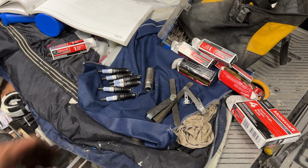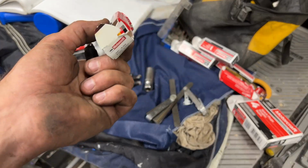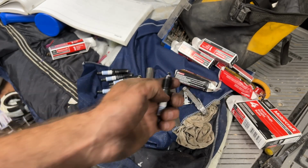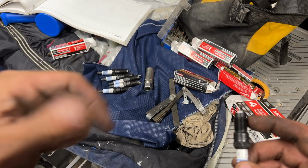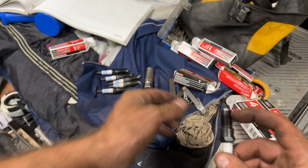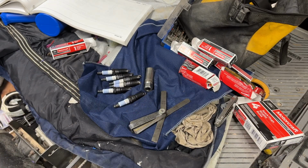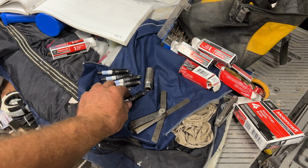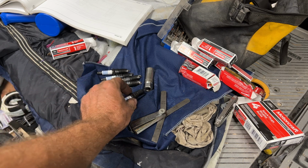Okay, the next step to the supercharger install, we're going to install some new spark plugs. These ones are SP440s. They're the recommended ones for the SOHC engine. The normal gap for Rangers, well, this year Rangers anyway, is 62 to 68 thou. But we're going to bring this down a little bit. We just set it to 54. So it's tightening up the gap a little bit because you are using a supercharger. But again, I'm running such a low boost, it shouldn't really affect the spark much. If you were to go higher, you want to close it down. I believe in the manual, the instructions for the Moddbox kit, they say about 34 thou.